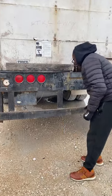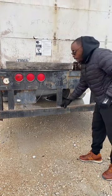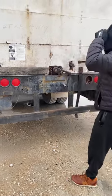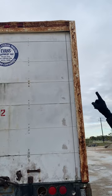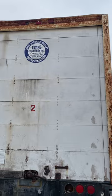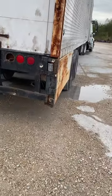Then I have my rear bumper. Our rear bumper should not be bent, broken, or cracked, properly mounted, and secured, and should not be more than 24 inches from the surface. We got our clearance lights up top — make sure that they're red in color, not bent, broken, or cracked, properly mounted, secured, clean and free of debris and moisture. And that's the whole truck. Nice work.